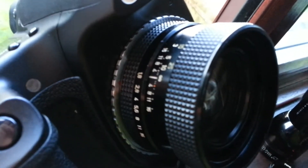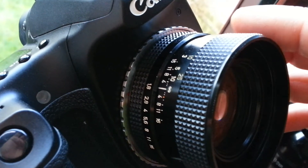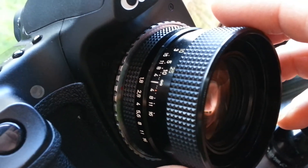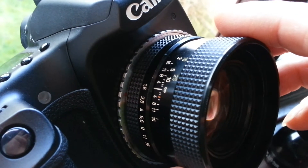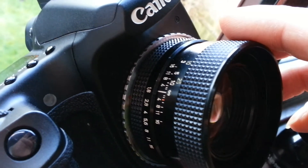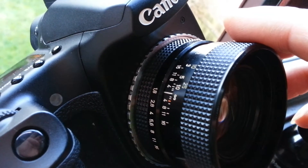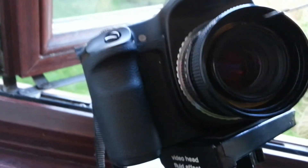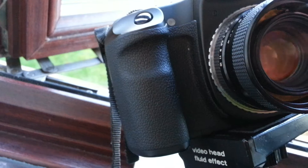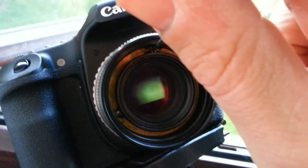Now, while watching, I'm not going to twist the barrel — I'm going to pull it away from the camera body. You can see it's moved away slightly. While holding it away, twist the barrel slightly back towards the ten-metre mark. That'll do. Then re-tighten one screw for the time being just to test the focus and see if it's made a difference.